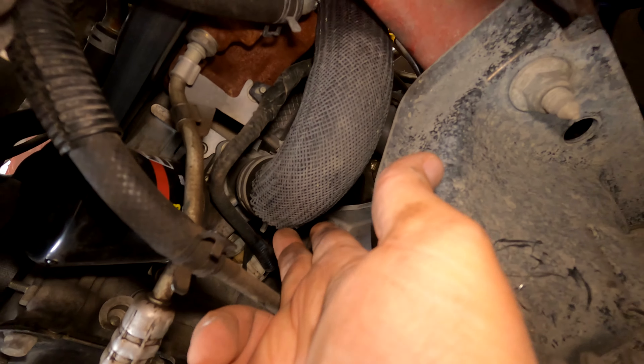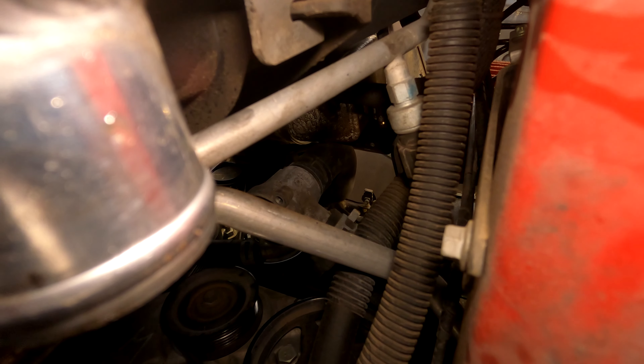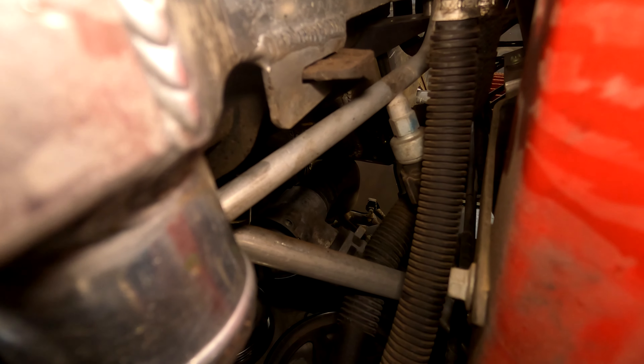The next one to come off is this one that loops behind the oil filter, so you're gonna need some long pliers to grab this one. Then that comes up and over - it's hard to get in here - that goes up and over to the thermostat housing in the center of your screen. So we need to take that hose off and then we'll just right away put the new one on.